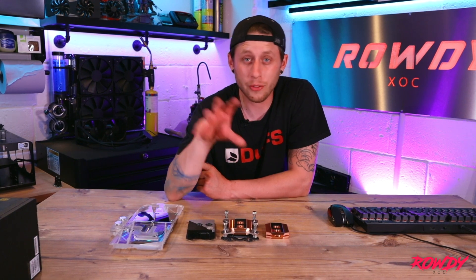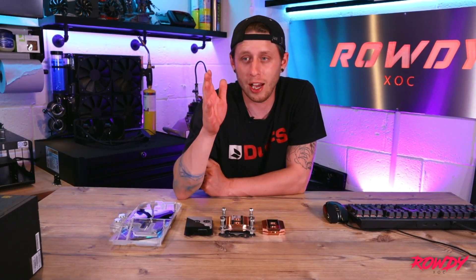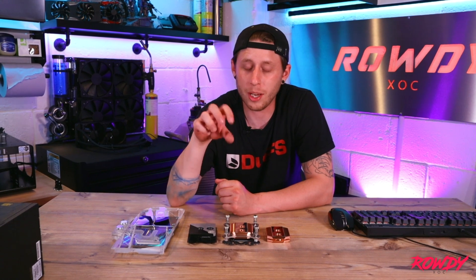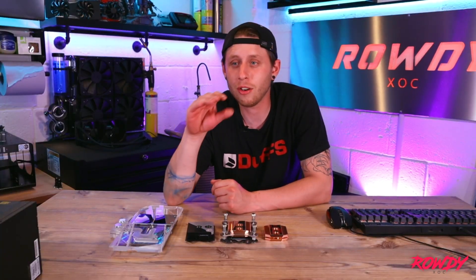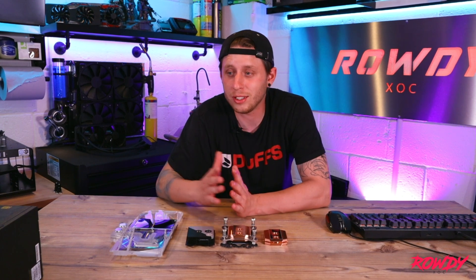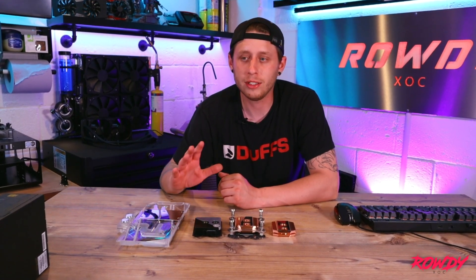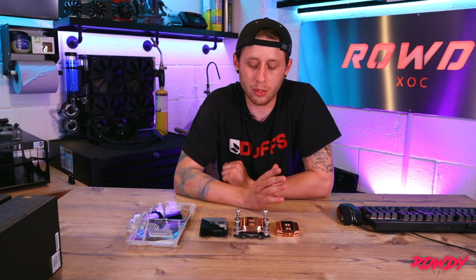Different blocks will have marginally different flow rates, but this only really comes into the higher-end blocks. When you start looking at the higher-end market, they'll be talking about adjusting flow using something called a jet plate — which I'll explain in a moment. You can swap out different jet plates to increase or decrease the flow. Again, if you're just starting out, don't get hung up on that. If you're spending anywhere between about £40 to £70, that's going to buy you a nice mid-range block. You can go all the way over £200 now for water blocks, which will give you a really great-performing block, but real-world gains — especially on ambient watercooling — you're probably not going to notice.